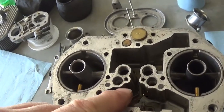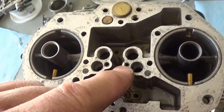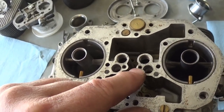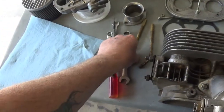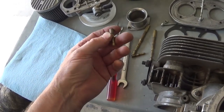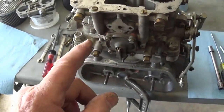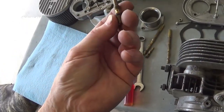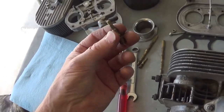Now, what did I want to show you? These little holes right here, you have them on Webers and you have them on these. If you get what they call an update kit, you put the little lead plug in that hole, and instead of having a short jet stack, you have a tall jet stack. And sometimes you keep pulling your idle jets out and blowing through them and checking, and it's like, why is this thing snapping and popping and it won't idle smoothly? Well,